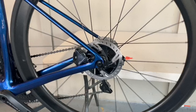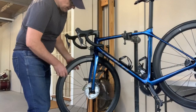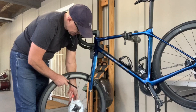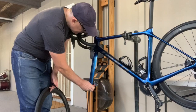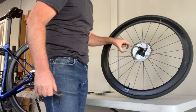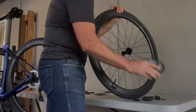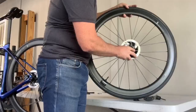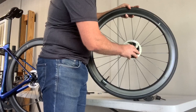Now we move to the front. It starts out the same — use the removable lever, take the axle out, drop the wheel out, and pop the provided spacer in to clip between the caliper pads so they stay nicely separated. On the front wheel we do exactly the same process: cassette removal tool in, undo the lock ring, rotor off — that's the 160 — and put the 140 on. I'll use the same black lock ring because I prefer that look.